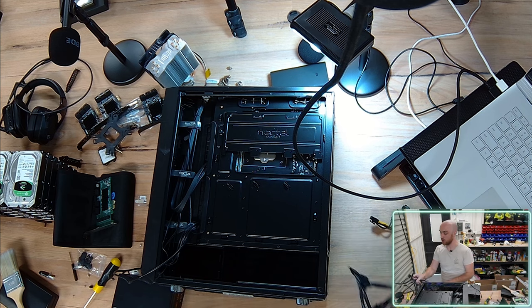Because power goes through pin 1 out of the power supply and ends up at pin 8 on the motherboard side for vendor A, whereas socket 1 on the power supply side for vendor B might actually go through to pin 6 on the motherboard or something. It just might not be mapped out one-to-one. I know that's definitely the case, that they're not always mapped out one-to-one. So you do need to be very, very careful with that, and you can blow components.